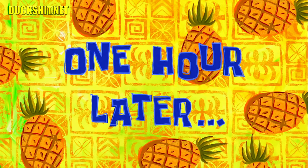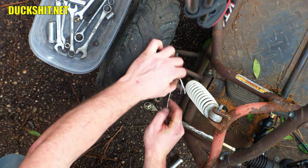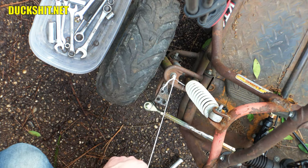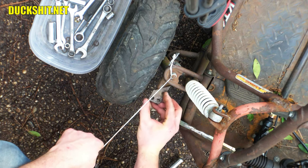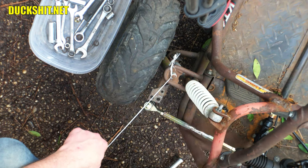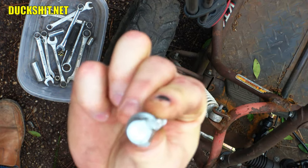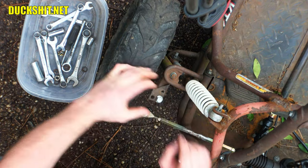One hour later. The first thing I want to talk about is that I extended this tie rod in — we'll get to why in a minute. You remember the string from earlier: if I attach it to the ball joint and run it toward the front, it pushes inward at a certain angle. I made a little piece that intersects with that line. Because the steering rack is ahead of the front axle, the string actually needs to come out the opposite direction, so this piece is mirrored and flipped over — now we intersect the string on the opposite angle, which is correct. I had to take the head down on one bolt just a little bit because when I pushed the tie rod in, it wouldn't clear, but that actually makes it fit.